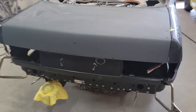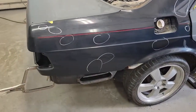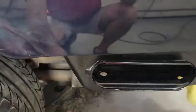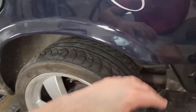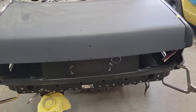I've got it partially clamped in here. I've got it down on the weight of the suspension so that I don't have anything flexed — it's going to be where the car is going to ride. I went ahead and welded the front under here from inside the trunk to hold this piece in for me, and then dropped it down on the weight of the car to weld it along the frame rail inside there underneath. So that was with the car on the floor, which is a little less convenient, but you can't have the car hanging off the stand when you weld anything to the structure. I'm going to leave it here until I get everything kind of locked in position, then I can pick the car back up and finish all the welding — but I can't have it moving.